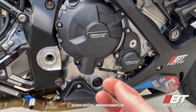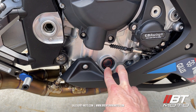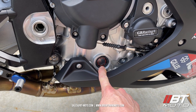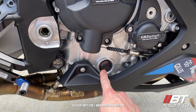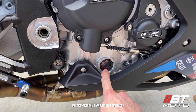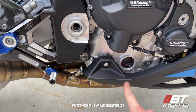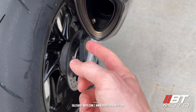If the oil is getting into the combustion chamber, that means the fuel is getting into the oil. A good indicator of a bad break-in procedure is the oil starting to blacken very fast, get contaminants in it, and lower — meaning you're not going to have as much oil level as you did when you first got the bike. It should be right in the middle when you first buy the bike. If it's at the very bottom of the gauge or not even visible, you have a problem with oil consumption. You'd probably look at your exhaust and it's completely black.